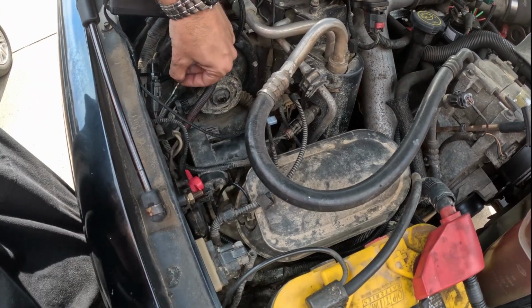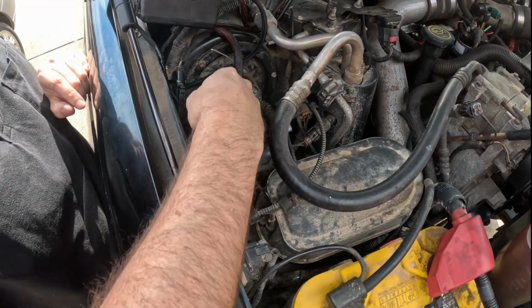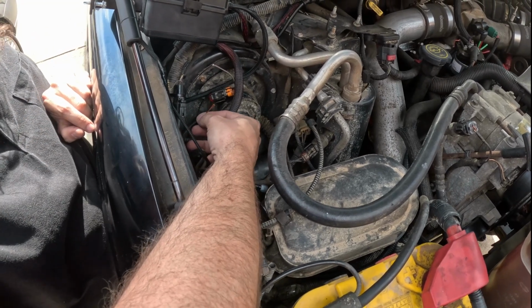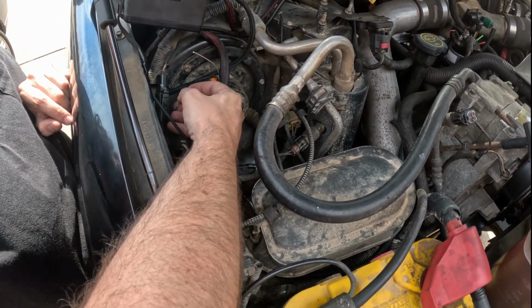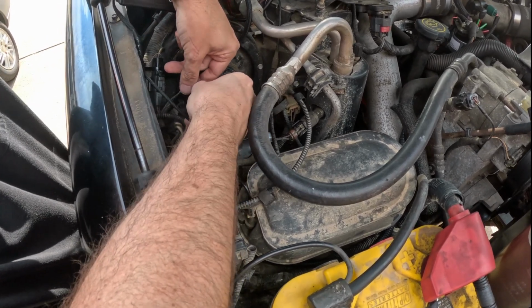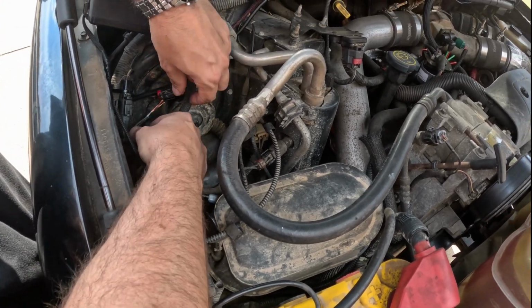There's not enough room in there to operate, but those wire strippers are nice and easy. See how the wire is now basically stripped, right where the cut was in the insulation. So when I go to splice the new wire on, all I'll have to do is cover that up with heat shrink.